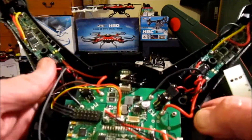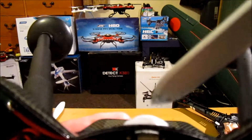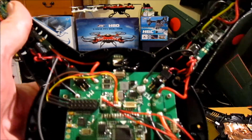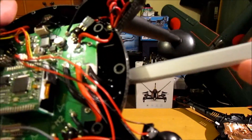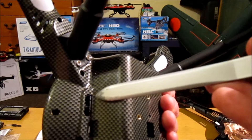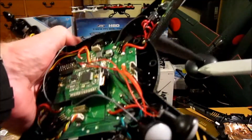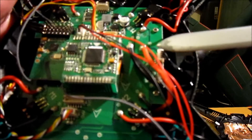Attached to the main board you have your rear LED — the light on the back — that plugs into the main board. Over here, this plug goes down to the data board which feeds the pins, controller, and the USB. If you damage any of these ports and need to replace the data board, it's underneath the main board and connects on over here.